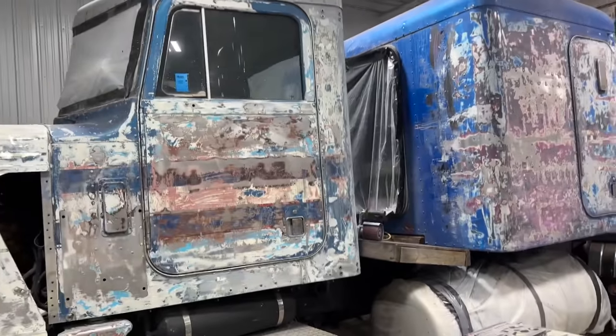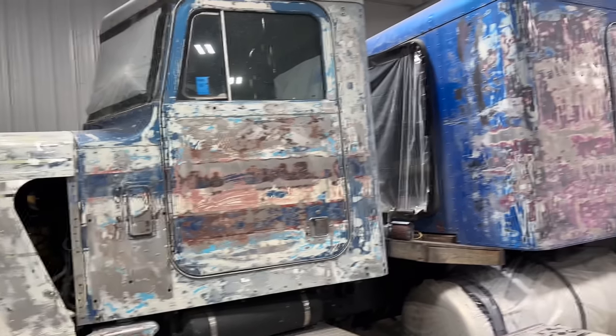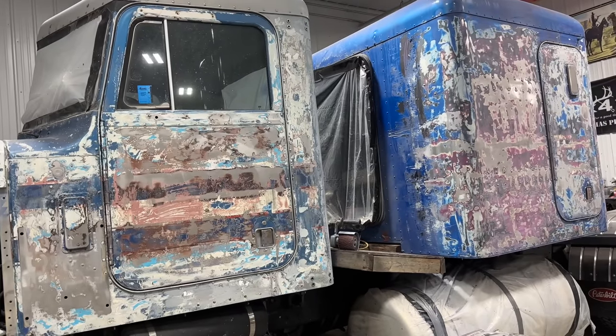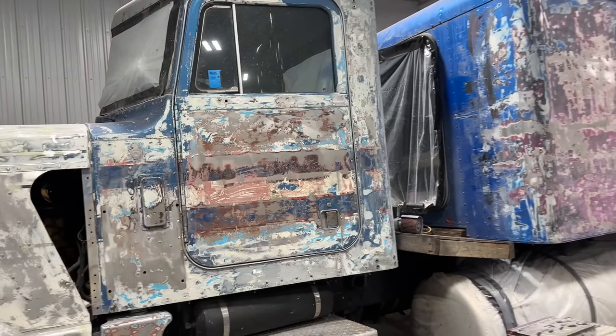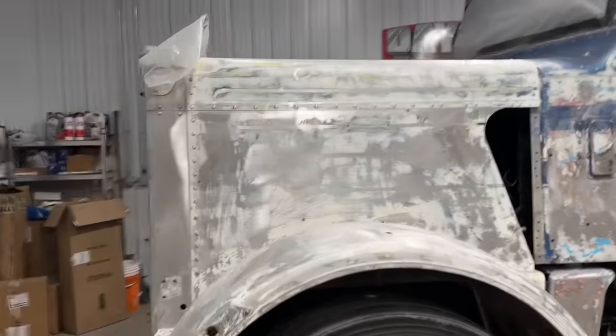Because there will be so much bare metal, I need something to adhere to the bare aluminum. And then probably one, maybe even two coats of high build primer to get this thing as smooth as I can and have a really good palette to put down some nice metallic blue paint and have a pretty sharp looking truck as an end result. So actually doing body work is not that much fun — it's a lot of hours, it's a lot of time, it's a lot of effort, and it's just not that exciting. So hang with me on these videos, I know it's probably not that exciting to watch.